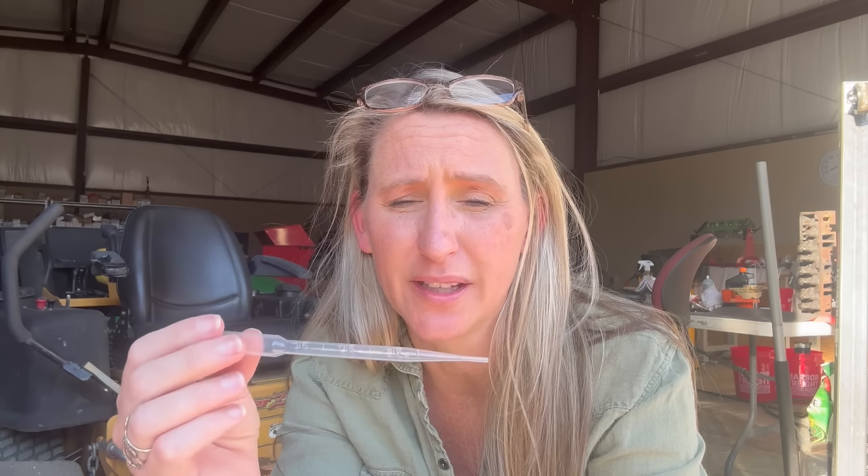If you only knew how many trimmers came into the shop and that's all I had to do. Now this is going to get a lot of you going, but if it still acts boggy after that, the first thing you're going to want to do is check your fuel. I leave these little pipettes in the description box below. All you've got to do is go down to the bottom of your gas, suck it up, and see if there's any water or debris in there so you know if you have to get rid of that fuel.